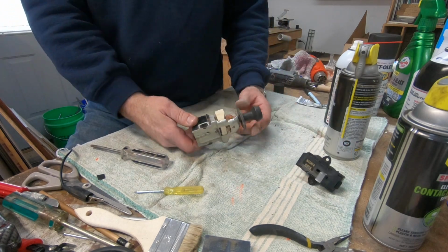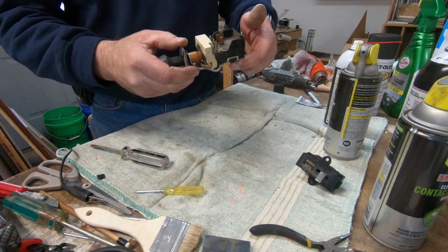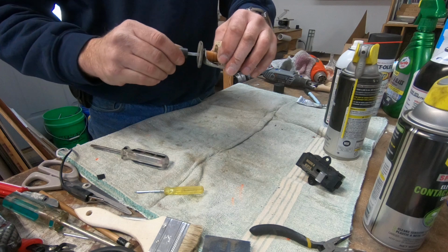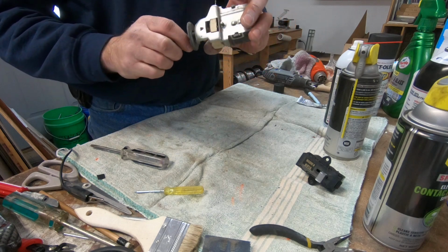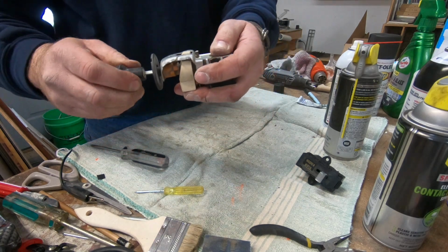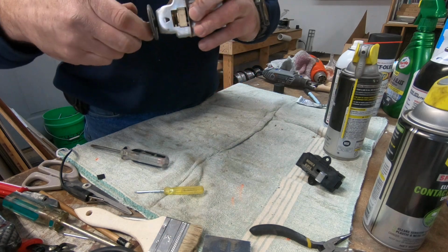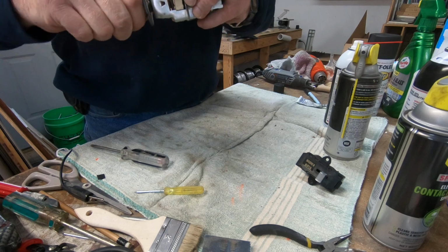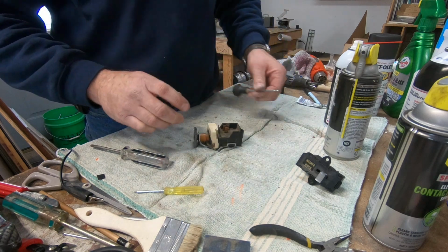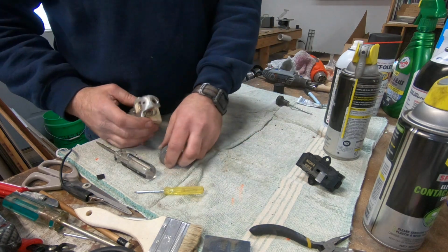The next switch is a headlight switch. If you've never pulled one of these out when this is in the vehicle, the knob doesn't come out because you have to push. There's a little spring button there. Once you get it out to that point, you push that down, work it a little bit. Be stubborn, and out it comes. See, it's got a little catch on the end there, a little point. So that comes out. This is the nut that holds it into the dash.